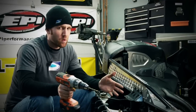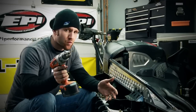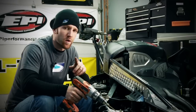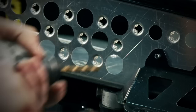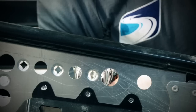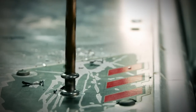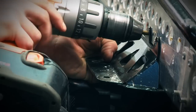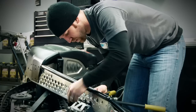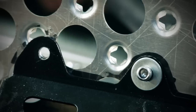The Assault is designed to have a 146 inch skid, however the tunnel is the same as a Switchback, so we're going to drill out the riveted rear arm bracket and remount it in our new location. We took measurements from a current IQ chassis with a 136 inch skid frame so we know our measurements are correct and can check back with that sled as our guideline. Once the brackets are in the proper location, we'll drill and rivet them back on, ensuring we use healthy sized rivets capable of doing the job.